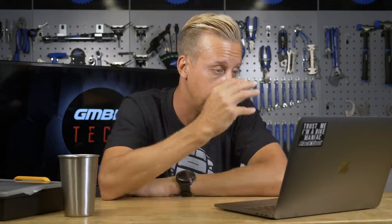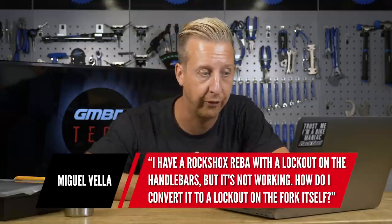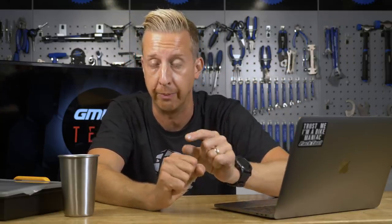Final question from Miguel: he's got a RockShox Reba with a handlebar lockout that's not working, and he wants to know how to convert it to a lockout on the fork itself. On a RockShox Reba — in fact on any RockShox — they have motion control dials. Depending on which damper you have, you may be able to change just the dial on top, or you may need to change the actual damper unit. It's not the end of the world — you're probably talking about a part that's around 30 or 40 quid. You basically unscrew that from the top of the fork leg and instead of having the dial operated by the cable remote at the bars, it has a separate dial — probably a low and high-speed compression or a three-position dial, depending on which model you have. You can check this on the RockShox website using your part numbers. I've done it before — just look it up and good luck.